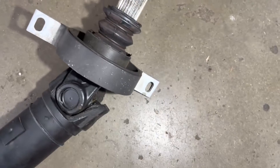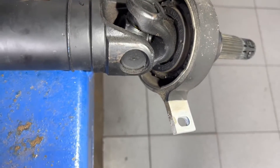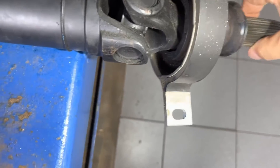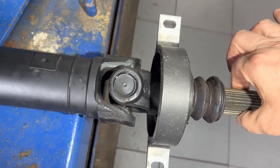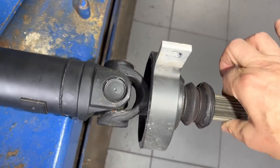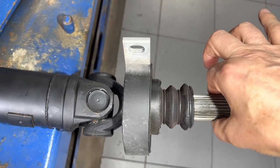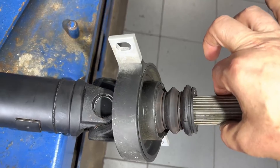The reason we separate the shaft is not only to inspect the splines but to carefully check the u-joint. Obviously if it's loose you would see looseness right away, and you would usually see a little bit of rust staining. But most of the time what we're looking for is smoothness, consistency, and resistance in the u-joint. When it performs, there should be reasonable resistance — equal in both directions — and as it moves up and down it should be absolutely smooth throughout the full range.